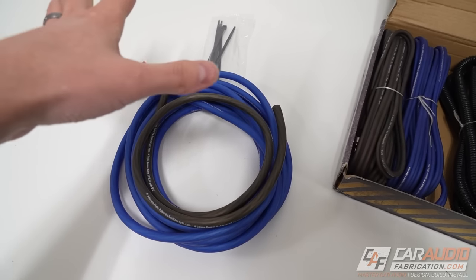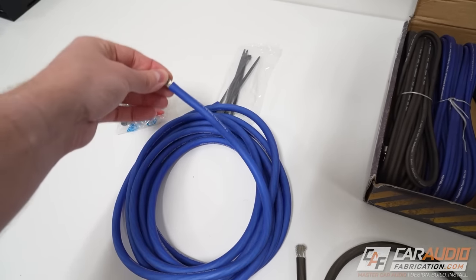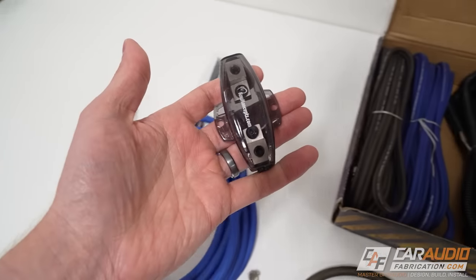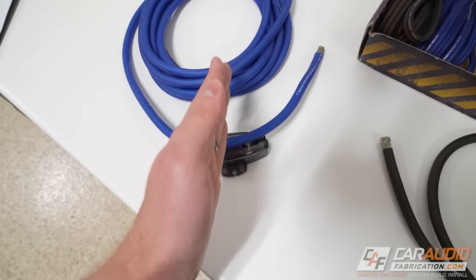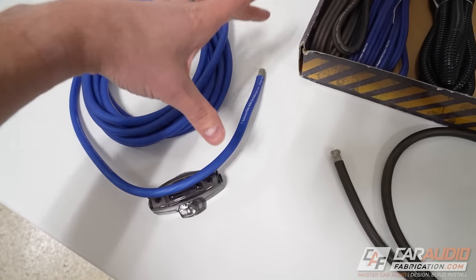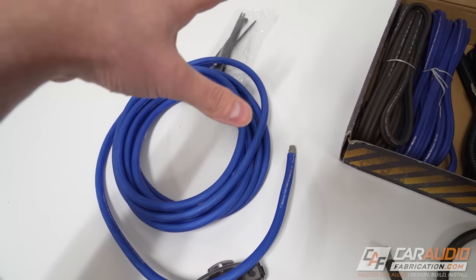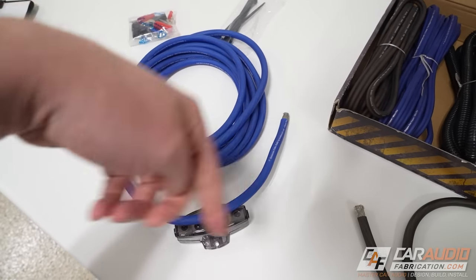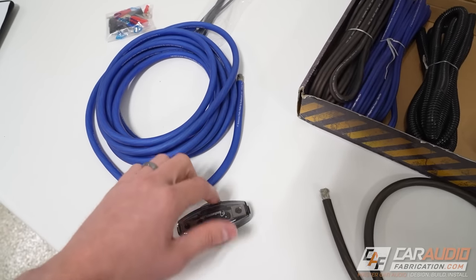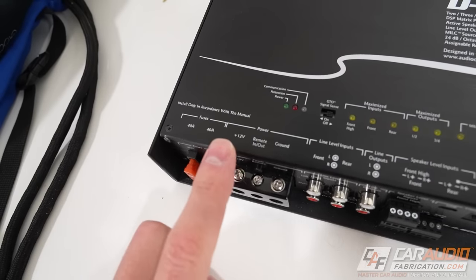It never hurts to do a rough measurement from where the battery is located to where you plan to run the wire back to the amplifiers to make sure the kit has enough length. For most vehicles, 18 feet will be more than enough, but for really large vehicles, double check. For installation, connect one end to the battery and cut the wire close to the battery to install an inline fuse. That section between the battery terminal and the fuse is technically unprotected, so the fuse protects against shorts — if the wire gets nicked and touches the vehicle body, the fuse will blow instead of burning the wire.